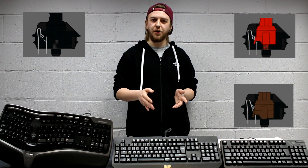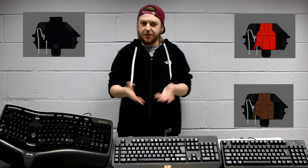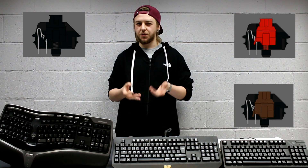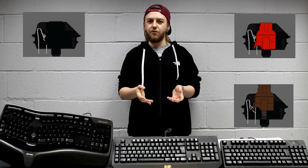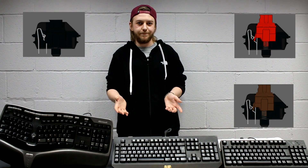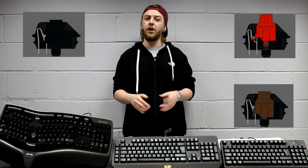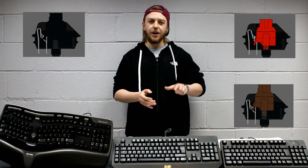Compared to black switches, brown switches are quite different. The brown switch has a very similar actuation point to a black switch — kind of in the middle of the keystroke — but it actually has a tactile bump, a registered point which you can feel with your fingers when the key press is registered. This tactility is preferred by typists or touch typists who want to type as quickly as possible. Because you can feel the actuation point, you don't have to press the key all the way down to ensure the keystroke has functioned properly. This tactility is also preferred by some gamers who appreciate feeling exactly where the key actuates. You'll actually start to learn where that bump is in the downward press of the key switch itself.